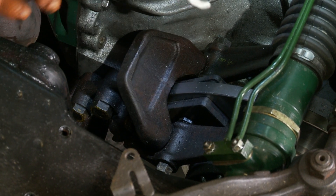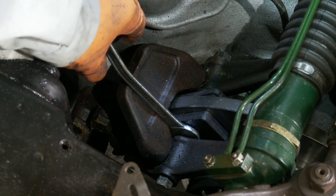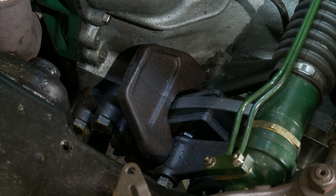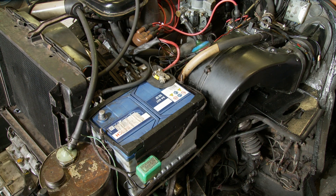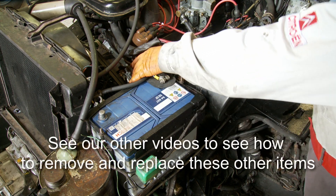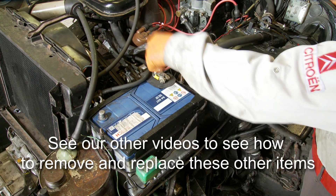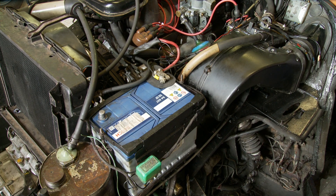The notch in the special tool allows you to get the spanner out from there, and the fact that it's thin also enables you to extract it from the tight space. On the other side of the car, as you can see there are quite a few other bits in the way. In order to get down in there, you're going to have to remove the battery and the alternator, and you'll probably have to drain the coolant to get the lower coolant pipe off before you can do any adjustment. This is why it's rather awkward. You can get at it from underneath, but you would need a hoist and long fingers and be prepared to get your hands really dirty — but it can be done, although it's awkward.